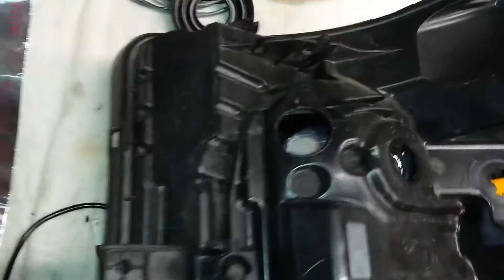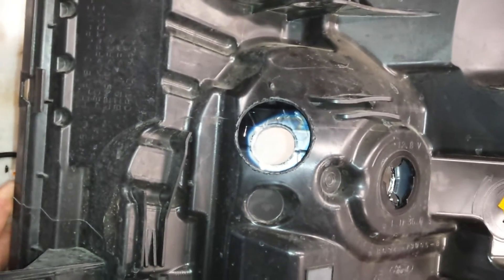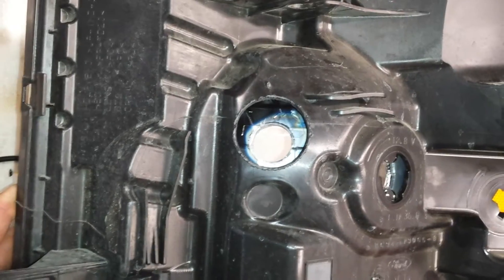What this includes is your LED hideaways mounted right here next to your parking lights in the headlight capsule. It's a dual wall capsule, meaning it has two layers — the inside chrome layer and the outside plastic layer. We penetrate the outside layer first with a two-and-a-half inch hole saw, and then the inside with a one inch hole saw.